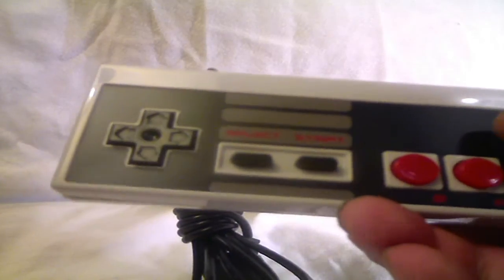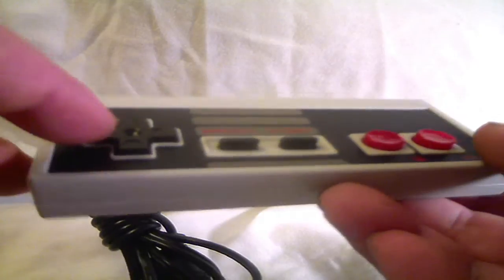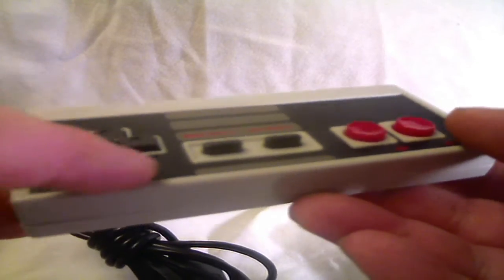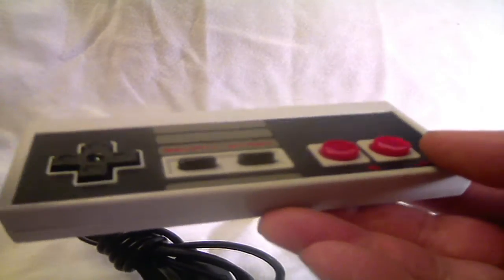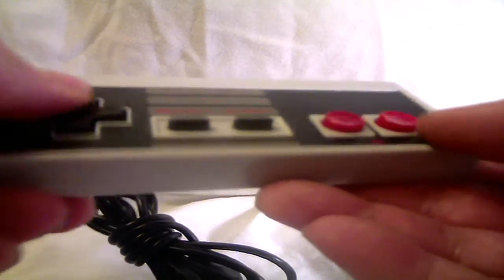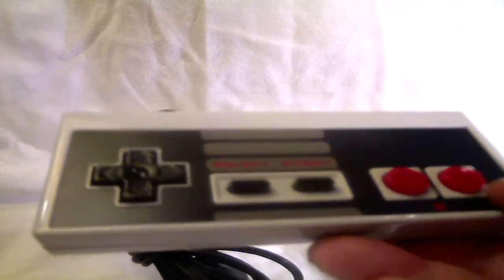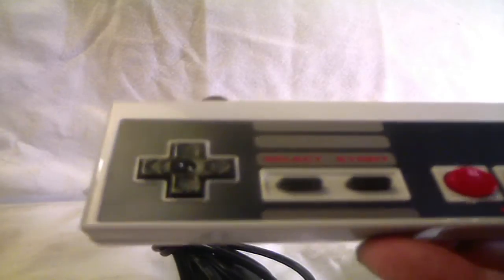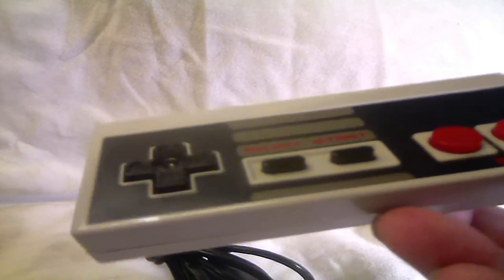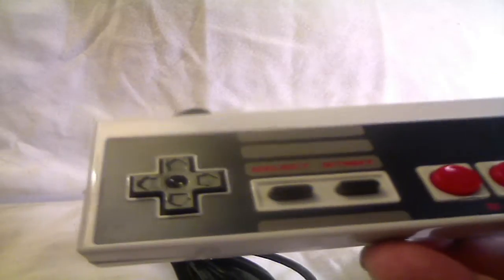And I found something out that was very, very surprising. The D-pad, under each one of these ends here, has a little piece that pushes down on the rubber, and in the center there's a ball which gives it pretty much free range of control. Well, on the up button part, there was a little piece of flange left over from when they milled the plastic, and it was pushing down on the button no matter where you pushed.